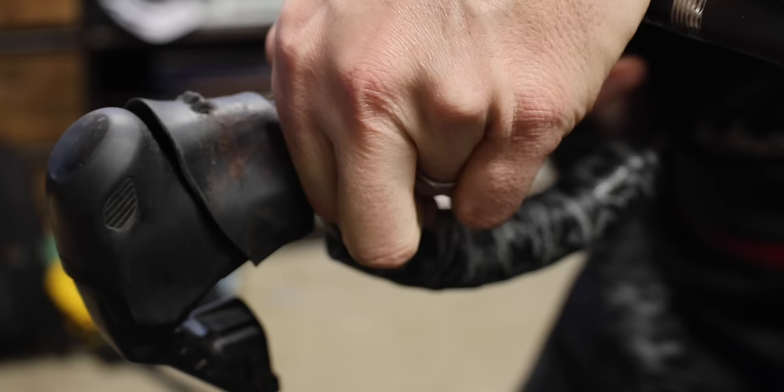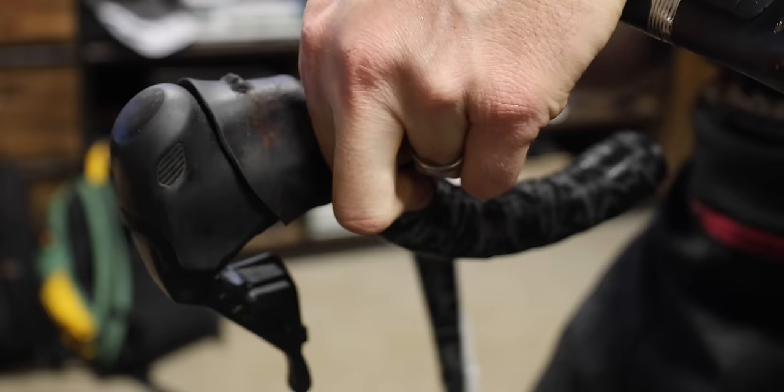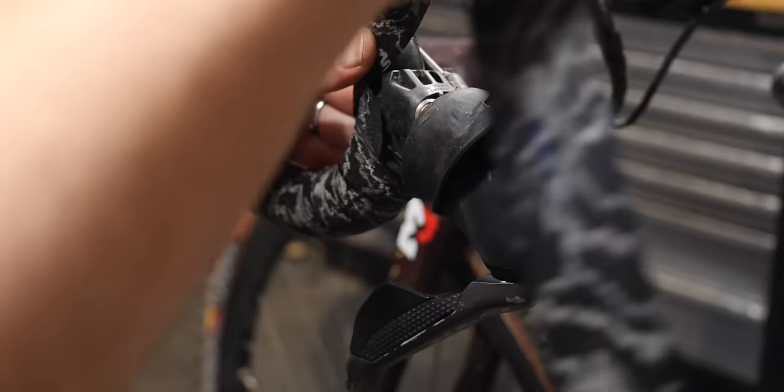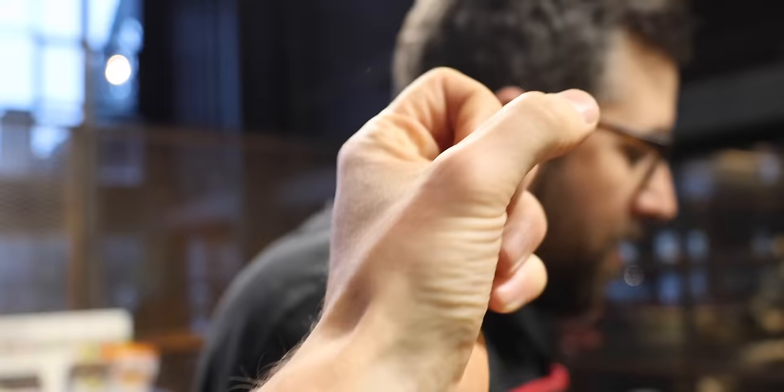Then it just goes around. Loop around the back at the bottom just to cover everything. Put it tight and then around and up. We should probably make a video of different ways of taping bars at some point. This is 4.6mm handlebar tape so when you wrap it twice over it'll probably be about three times as thick. Never reach the brakes - it's probably the only reason you ride so fast because you can't brake.